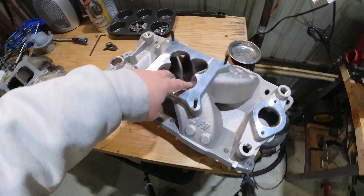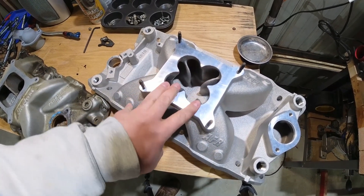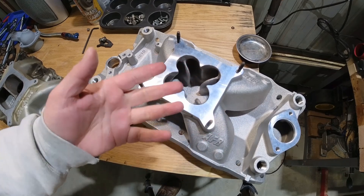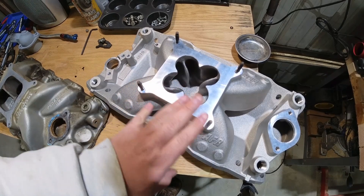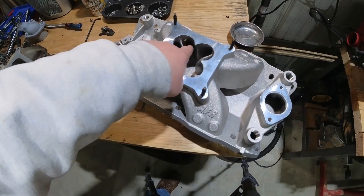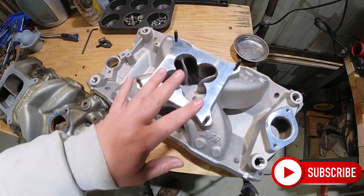As air flows through the carburetor it is atomized and ultimately vaporized in the intake manifold. Single-plane intakes have a moderately large plenum — the plenum is basically a battery for all the cylinders to draw from, and it can make carburetors behave a little differently depending on setup. Because of that big plenum and large intake runners, you could surmise it would be a little lazy on throttle response, and below 2000 rpm it may be a bit of a bear, but that's okay.